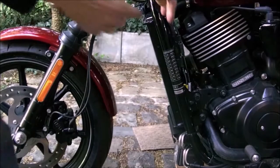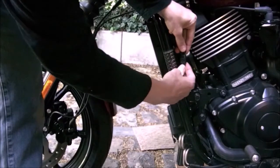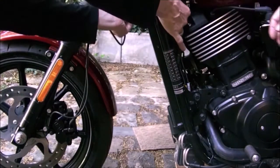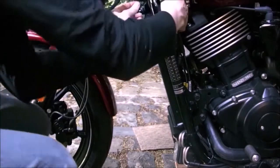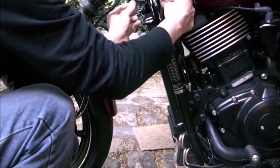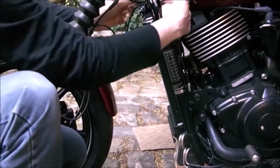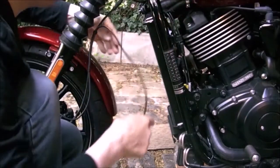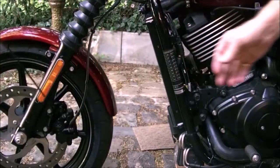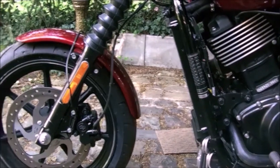So once the ABS is unplugged, you want to unplug the sense line to the wheel speed sensor. We've already cut the thing. Where's the little... Ah, right, there's a little plug there. Pull that. Drag out the sense line. It's tangled up around the cables, goes over the top. Try taking it underneath, and unclip it from here. That's just plastic clips you can unclip from here, and it's not actually plugged into one of them. Just hang the sense line up out the way. Okay, so that's that out of the way.